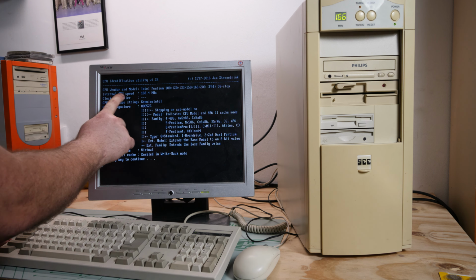Power supply has a pass-through for the monitor that was really common back in the days with AT systems. We have 2 COM ports, one 9-pin for the mouse and one 25-pin. We have a parallel port. We have an AT keyboard with a big plug. And we have also a PS2 port for the mouse. The bracket is in, but I don't really use it.